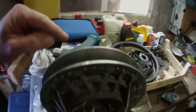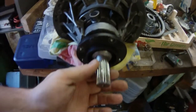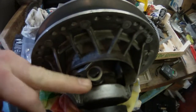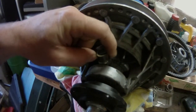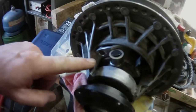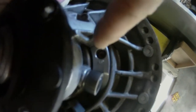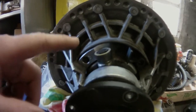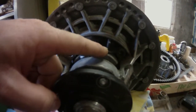One sheave, other sheave. This is the front side, that's the back side. This spline here goes into the rear wheel. That's a little roll, little wheel — we have another one on the other side. This is the helix; this one is a 45 degree. They also have them in 55 degrees, but unfortunately not available at the moment. This is the counter helix.